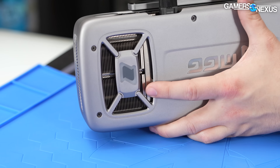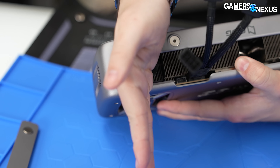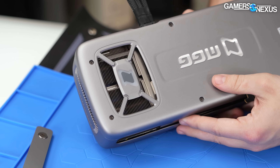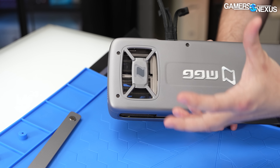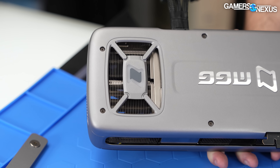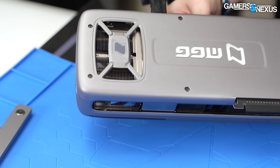That's why the fan on this side doesn't really do anything — the air is just going straight through. It'll pull a little bit of heat off maybe, but you'd really have to custom-tune the vBIOS to be useful here. The flow-through area has this plate somewhat blocking some of that flow-through. The impact here may not be that large. There are bigger fish to fry for the Mega Gamer card than this particular issue, but obviously it's sub-optimal — it's just whether or not that matters is a different story.